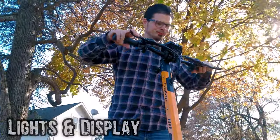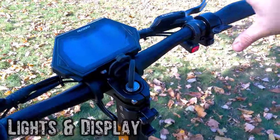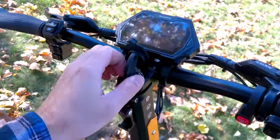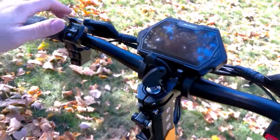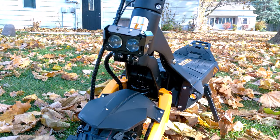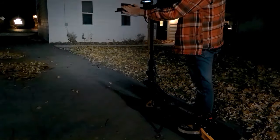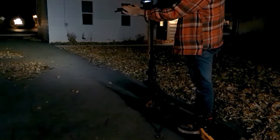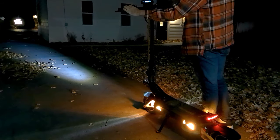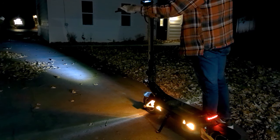Turning this thing on — well, I had to look at the manual to learn to press and hold the mode switch in addition to the key to start it. I felt dumb trying to flip the headlight switch thinking it was the ignition. Speaking of the lights, they aren't the brightest I've seen, but the highly focused beam makes them appear brighter than they are — about twice as bright as my typical 250-lumen bike light. The focused beam at an especially low angle means they excel at highlighting hazards in the road, casting long shadows from even small bumps.